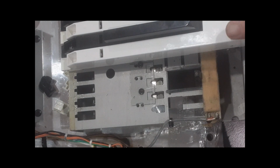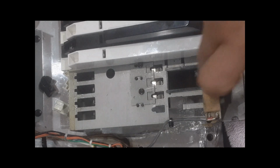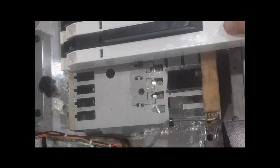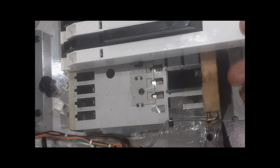As you know, with the X series, you could push a key, and then after you push it, you can push on it a little harder with different force. And this pad detects that aftertouch force, so you can play modulation, like bing, which you can't do on a piano. Some keyboards in the industry have a separate channel for every aftertouch. Yamaha does the full aftertouch as one strip, so it doesn't matter if you do two keys at once. It's the force together, not individual key force. It's the force together that ends up being the aftertouch force. So it's what we call common aftertouch, not individual. MIDI supports both, but that would have made this thing really more expensive with all the inputs that the processor would have to look at for each aftertouch.